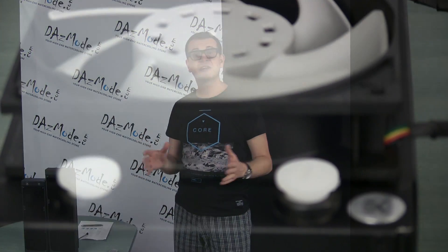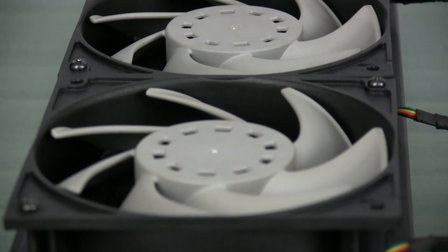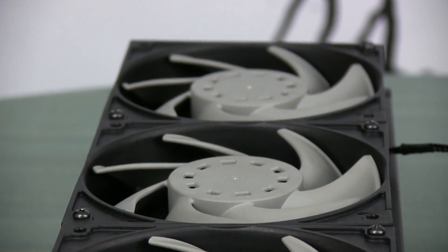What we will look at today is what is the better choice: the traditional triple 360 or the 140mm wide 420. I get asked this question constantly through my store and I had a little difficulty answering it. Usually I'm inclined to say 360 is better, simply because the selection of fans for 120mm radiators is much better than 140. Traditionally we only had generic, pretty weak fans in 140mm size, but recently things changed because EK introduced a new family of fans called Vardar, which showed very good results in radiator testing.